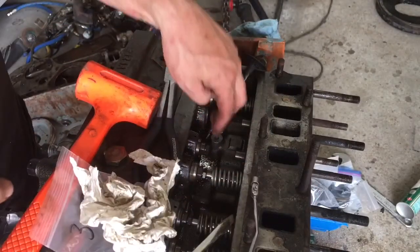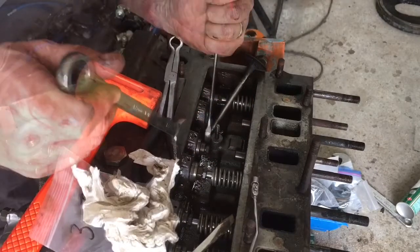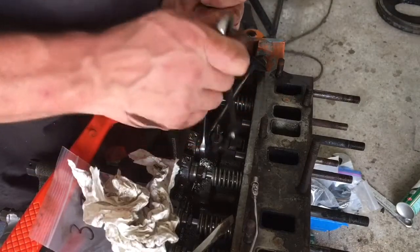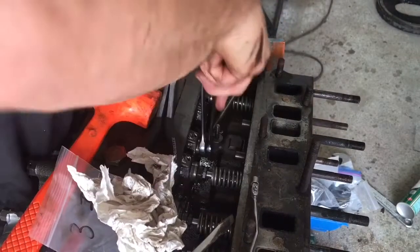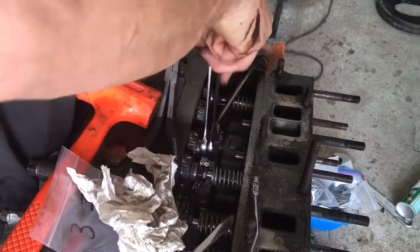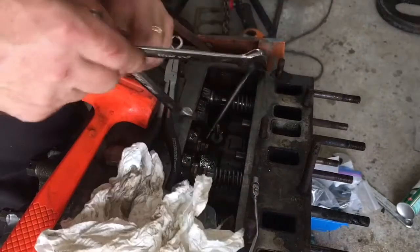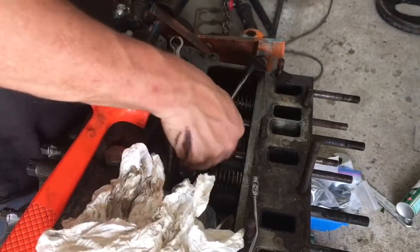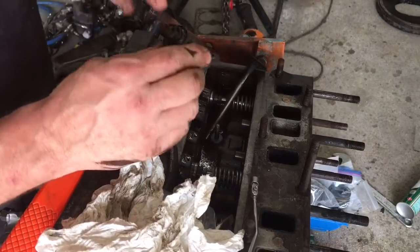For the keeper, come in and put a wrench on the flats of the lifter and spin the lifter. So to do this you're going to put a 9/16 on the lifter — that's all it takes, just that little bit.